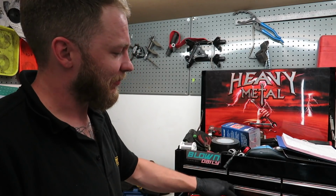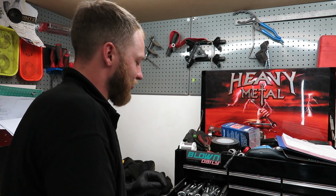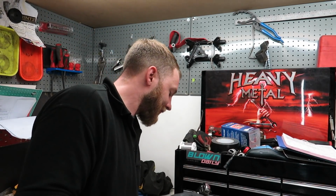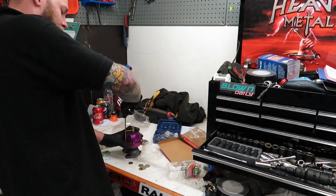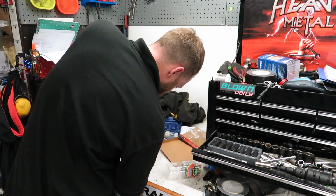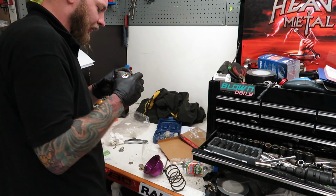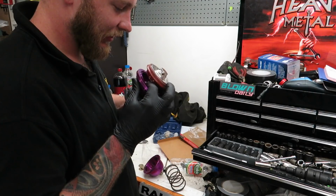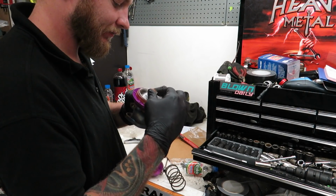I don't even know how to get that back in there. Get in there. There you are. Now I just need to find all my spare Snap-on stuff, because everything else is in my van. So I'm just going to strip this wastegate down. And the diaphragm looks like it's in good condition. Everything looks like it's still bolted up tight. I'll just probably run through all them little Allen keys there.